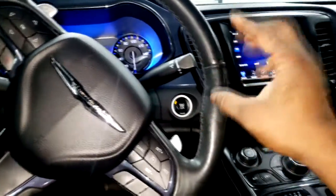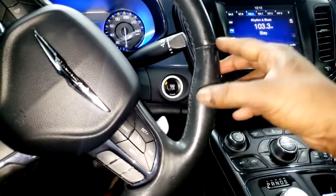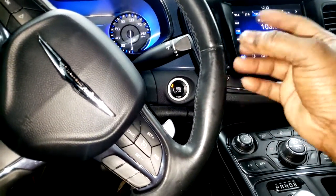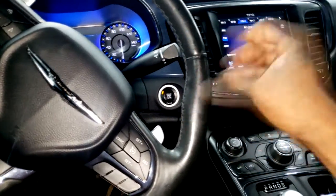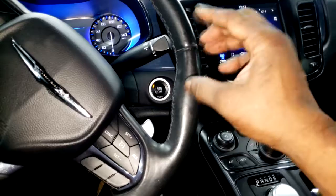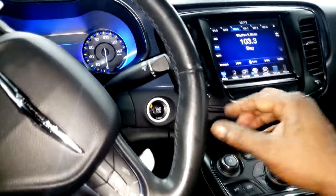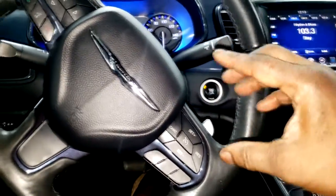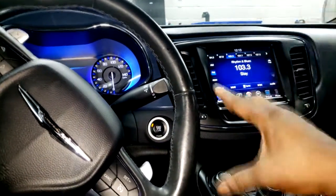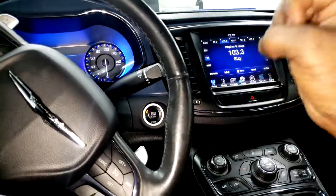Okay? Because you can't just simply say, well, I don't really use the all-wheel drive. Now, in some models, all-wheel drive is standard. It's a full-time all-wheel drive on some cars. So you have no way to disable it. You can't just say cut off torque to the rear wheels because I don't use all-wheel drive. No, in some cases, guys, you will be forced to fix that particular part. I'm still speaking about the PTU, okay? Even though you don't use it.